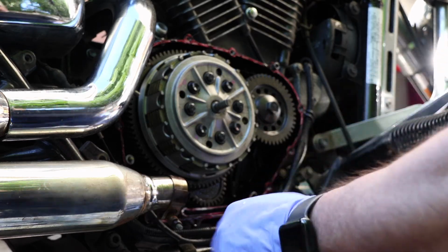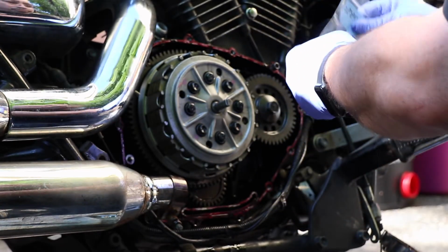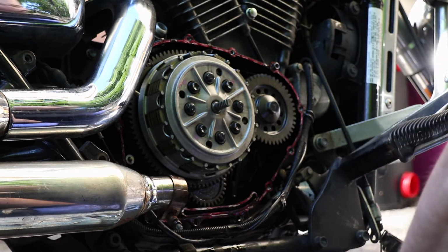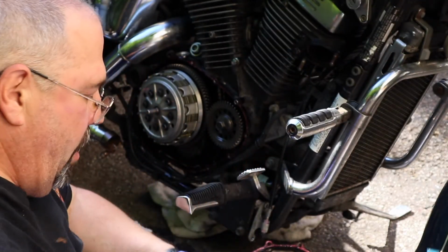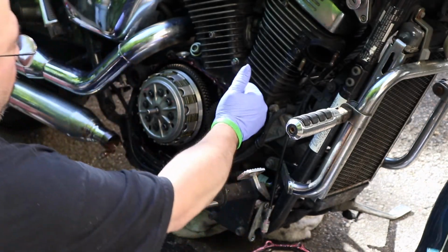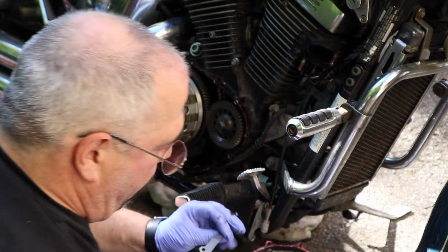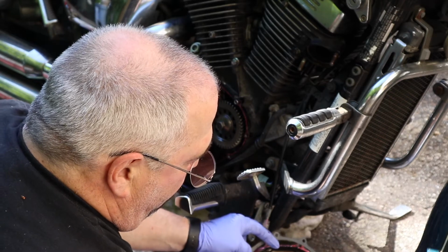All right. Now, there are two other little gaskets that go on either side of that clutch bracket. That's these. I ordered those along with the whole rest of the assembly. They're all visible in the parts diagram. And then, of course, our gasket. Now, what I prefer to do is kind of set the gasket in place. There's a little ferrule here and another little ferrule in the clutch cover. They'll give you a place to line things up. Make sure you get them on the right side.